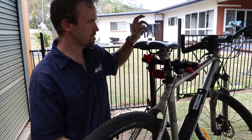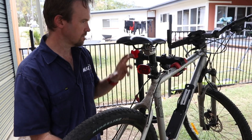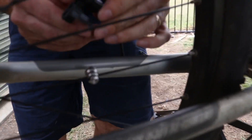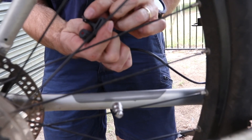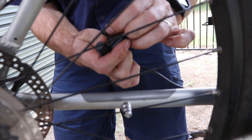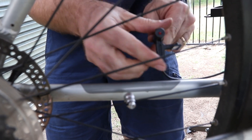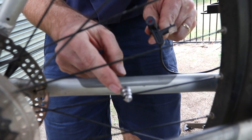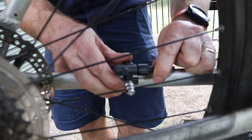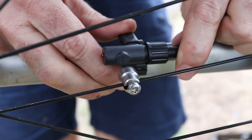Okay so we've just installed the computer, the throttle, and hooked those cables up. Now we're just going to hook up this speed sensor. We've got a sticky pad here — we've set this with the battery on so that the little LED light flashes every time the magnet goes past, and we've worked out the distance it needs to be away. So now we're just going to put that in place somewhere about here.